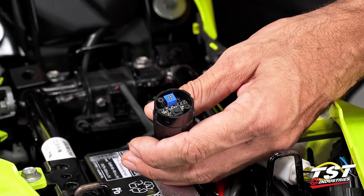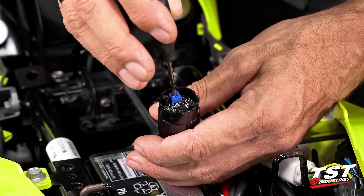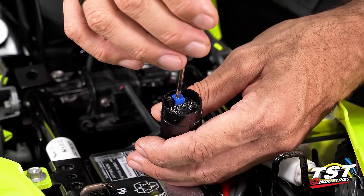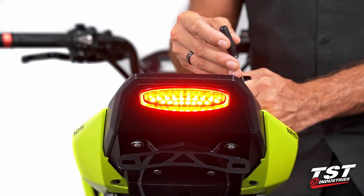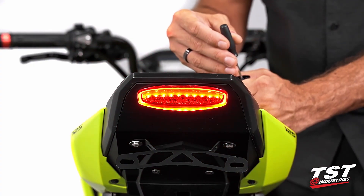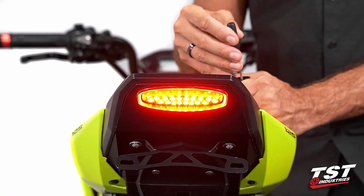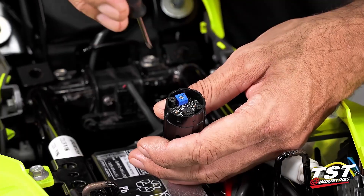For rate adjustment, we'll use the potentiometer. With the brake pressed, turn it clockwise to increase the rate and counterclockwise to decrease it. In brake alert mode you will only have nine flashes to make your adjustment before it stays solid. This mode doesn't lend itself to really fast flashing at the top of the range, and the bottom of the range is unusable, so I like to set it somewhere around three-quarters to 80 percent clockwise.